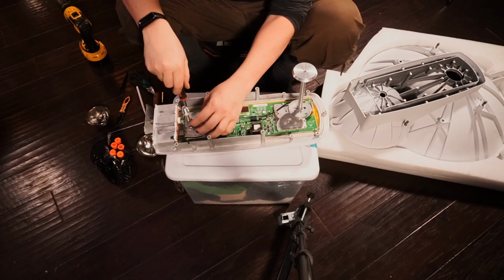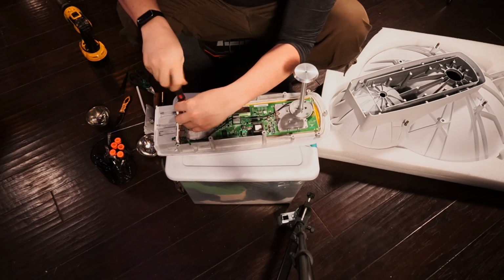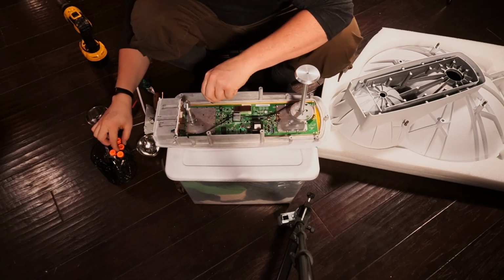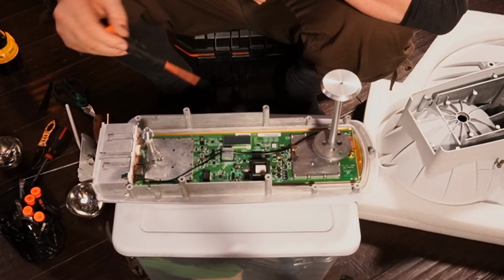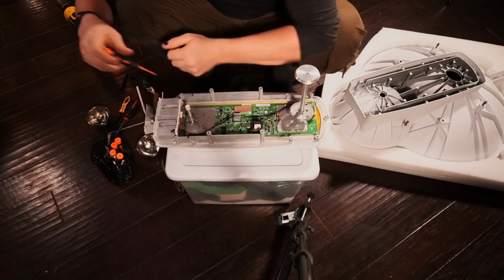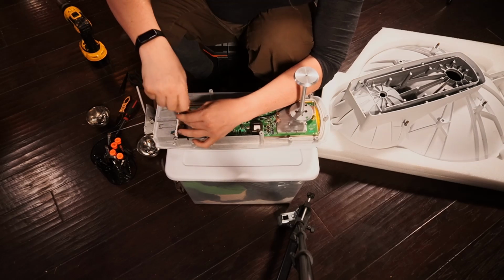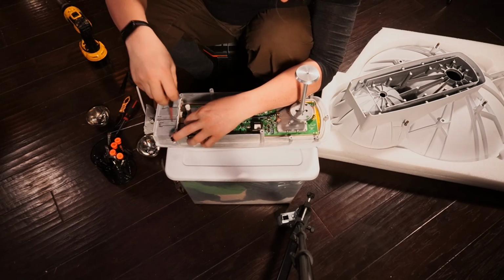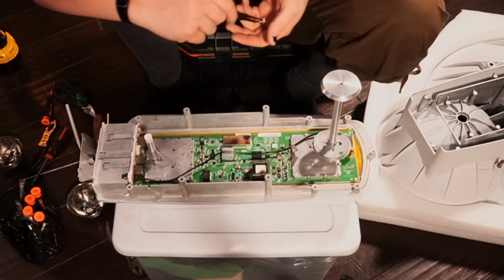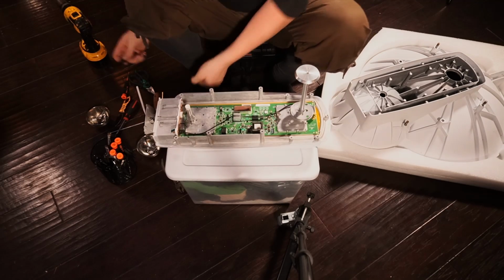So I'm very carefully going in on an angle, and I'm applying a bit of pressure to break the seal. You got to be very careful that you push firmly but not too hard, because you do not want to damage the head. I'm going to switch to a slot screwdriver, by the way, a very fine one that I can get in at a better angle. These are little tricks. Slots are kind of a universal in a way, but again, be very careful not to jump the socket. If you jump the little sockets, a little crisscrossy on the Phillips here, you will damage the screw and introduce filings into the board. And these screws are critical for this thing to work properly.